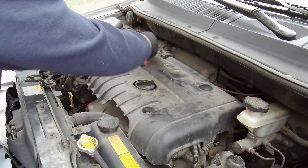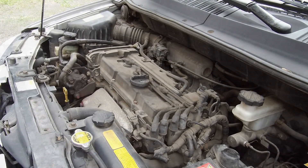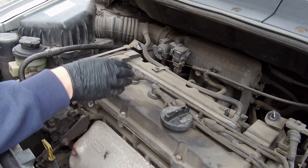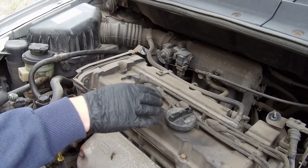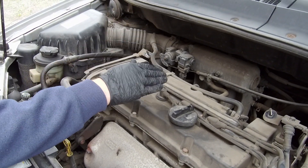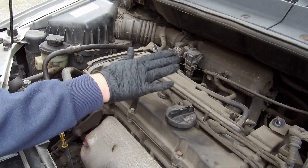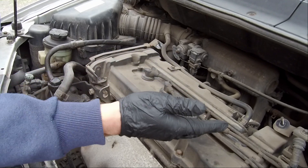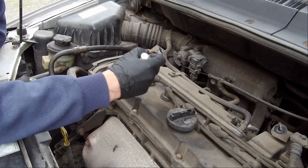As we can see, everything is hiding under that plastic cover, so let's remove and unscrew the four bolts. At the top there are ignition leads and they're really easy to take out. We'll check their condition first — we're looking for any white marks from burnout or mechanical damage. We count cylinders in this engine from the left side: first, second, third, and fourth cylinder. To help yourself, if you're not sure which wire goes where, we can mark them starting from the ignition coil side.